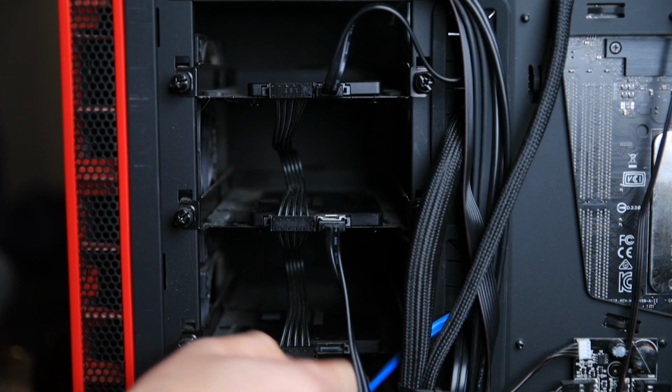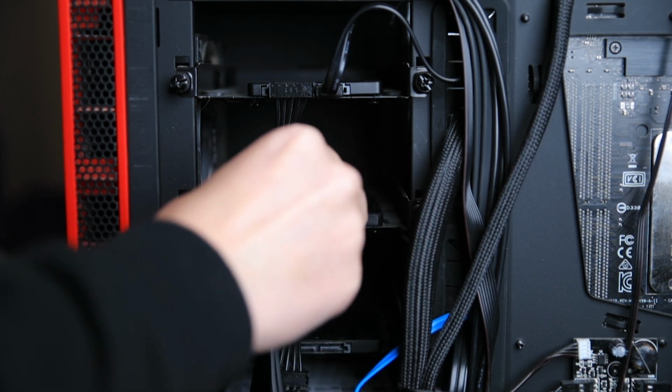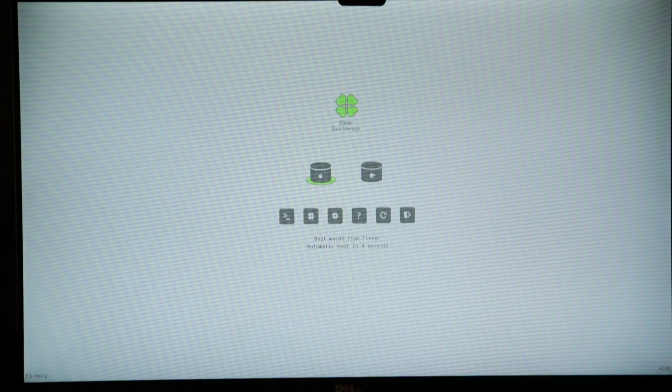So at this point, the next thing to do is unplug all the hard drives in your computer and then boot from the backup and make sure it's actually bootable. One reason people think that Carbon Copy Cloner creates bootable backups is they boot with both the hard drives in there, and what's actually happening is it's using the bootloader from your main drive and not the clone drive. So if your clone drive didn't have a bootloader on it, it can still boot because of the main drive. So unplug that and make sure everything boots from just the clone one, just to verify that everything's there. But if you copy your EFI and everything, you should be just fine.